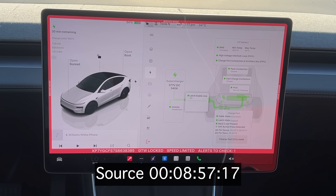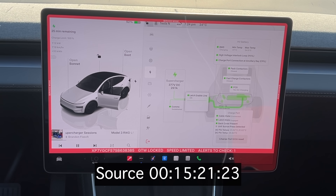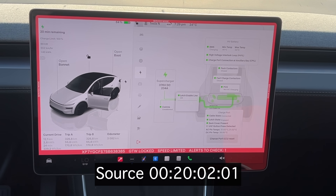Power reduces from 130 kilowatts to around 120 kilowatts by 40%. Between 40% and 50% it reduces from about 120 down to around 115 kilowatts — a very slow ramp down, which is good to see. But it's very disappointing to see this kind of charging speed at 47%; I would expect around 180 kilowatts to at least 70%. At 15 minutes of charging we reach 51%, and between 50 and 60% we're tapping under 100 kilowatts. That really isn't good.